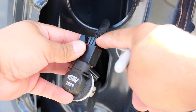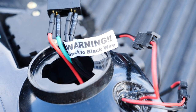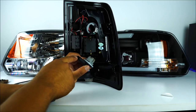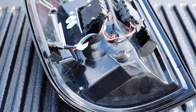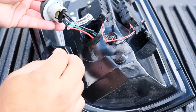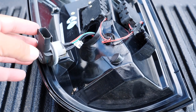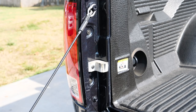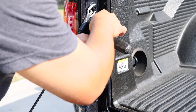When you connect it, make sure to mark the side with the black wire using a sharpie pen, like I did, so you know to match black to black wire. I was initially a little confused and contacted the company — they told me to match the black wire with the black wire on my vehicle. Otherwise you may burn out your OLED tubes and then you'd have to send them back. Also, there are only two T20 screws to remove for the tail lights — you need a T20 bit — remove those two screws and the whole tail light comes right off.